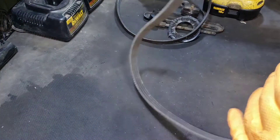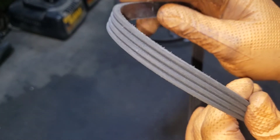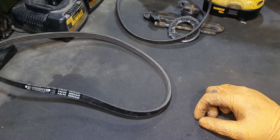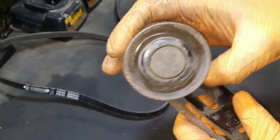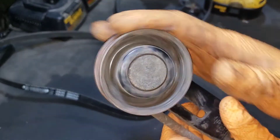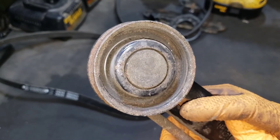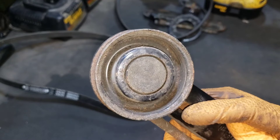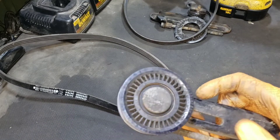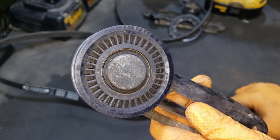This here is what a new belt looks like — no cracks, no damage, it hasn't been wrecked by dragging around a pulley that has way too much stiffness. This here is a good example of that: it looks good other than the rust cosmetically, but it's way too stiff. That's not a good thing — this thing's a piece of junk. So what does a good pulley look and sound like? Something like this — you can see it spins freely, there's no noise from it when I spin it.